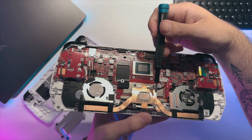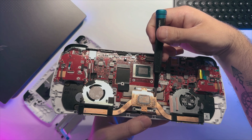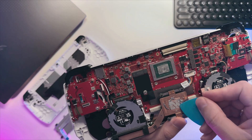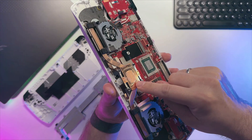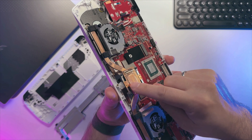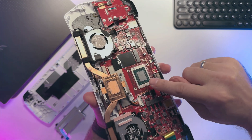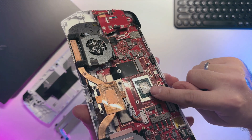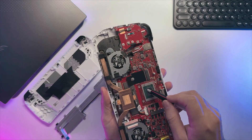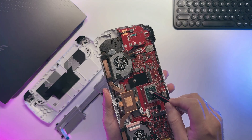As you can see, Asus have used a decently thick copper plate for our APU cover, which is nice. Here we have phase-changing thermal paste — well done Asus for being up to date. Also we can see that they either used an extra copper layer or it was left when milling for better die pressure. Again, well done Asus, and here we can see that the contact was perfect. Now I am going to clean both the APU and cooling block with alcohol and apply my favorite thermal paste, Apex from Alphacool.